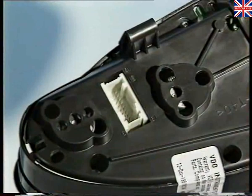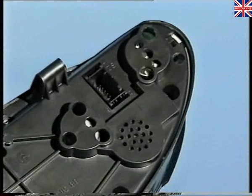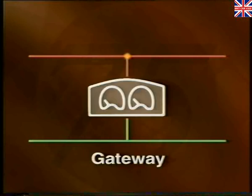The instrument pack is a vital part of the Rover 75's network and is similar to a telephone exchange inasmuch as all the messages are communicated through it between the various bus systems. Due to the differences between the bus systems, the instrument pack contains a microprocessor to convert and process all signals so that they're compatible with the other bus systems. Hence, the instrument pack is described as a gateway to all bus systems.